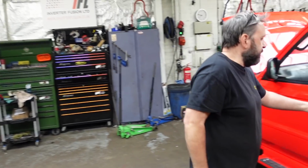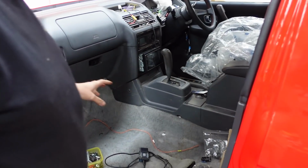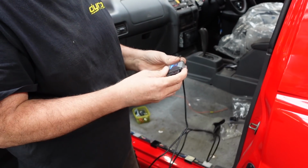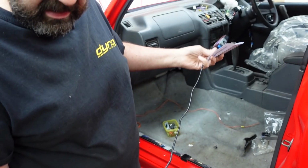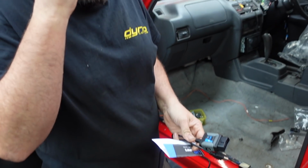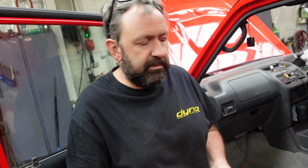The other thing we had to do with the GM ECU, when you wire it in, is that it comes security coded for the car. So Paul at Vortex sorted us out with this, which is basically HP Tuners. It's a little dongle. You plug it into your OBD, and then you can go into the ECU and do just about anything. Take the VATS off, which is the vehicle anti-theft. We've turned that off. You can turn off the fuel sensor because it hasn't got variable fuel pressure.